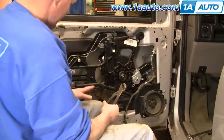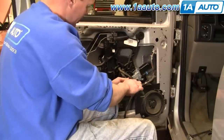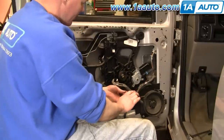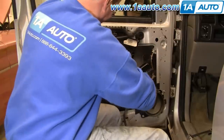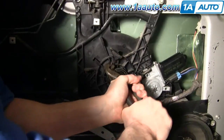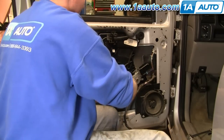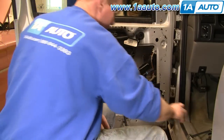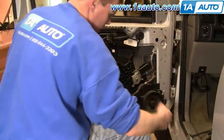I lifted the window up and used some painter's tape just to secure it. Now, with a nice big pair of pliers, to remove your window regulator you're going to release this balance spring. This spring has a lot of tension on it, so when you get it off be ready because it's going to want to turn your wrists. Grab hold of it, bring it off and around, and take that right off. Turn this counterclockwise with the screwdriver while you hold onto the regulator, then pull it out.